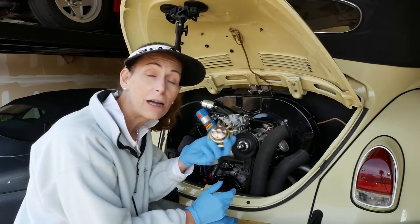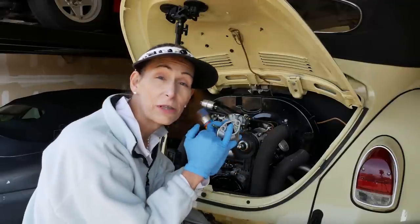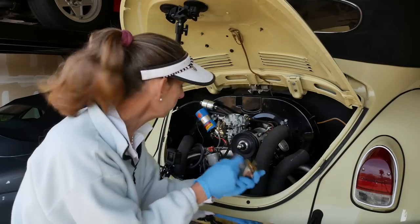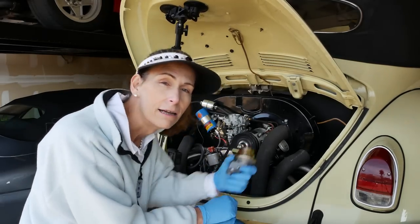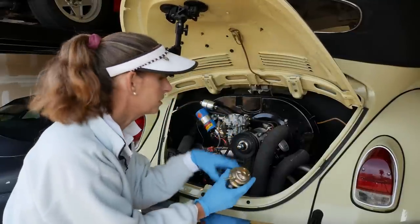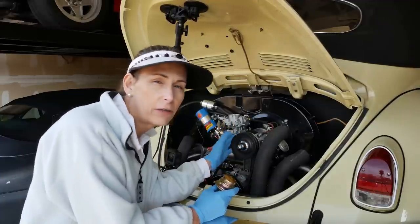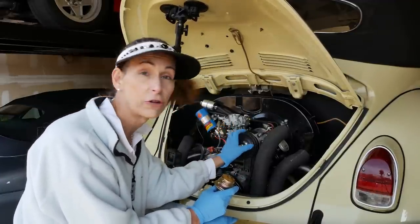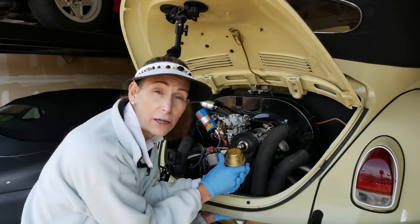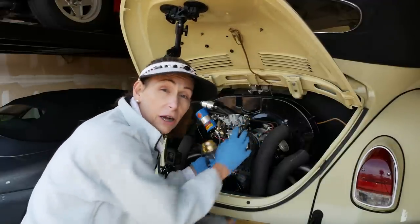At this point, we can go ahead and install our pump. We want to make sure we pack the bottom of it with some grease because we don't want this mechanism locking up on the pump. Now, quickly, there are two different types of pumps for these cars, whether the car has a generator or an alternator. In the mid 70s, 73 or something like that, they went to an alternator. The alternator has a bigger diameter, so it caused an interference on the old pumps, which were the taller pumps. And the alternator cars are going to have a shorter pump.